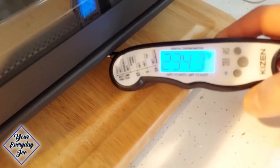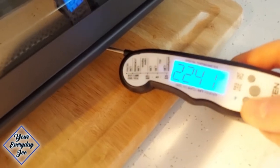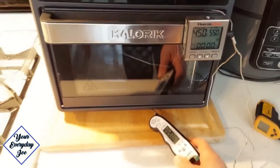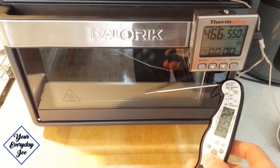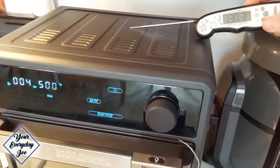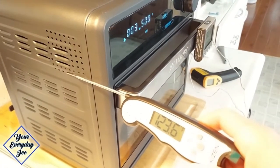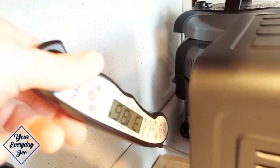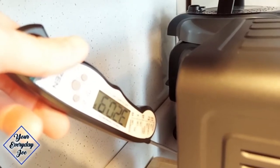While the unit was running at about 500 degrees Fahrenheit, I took some exterior temperature tests. At the bottom of the unit, running at 500 degrees, it read as high as 224 degrees Fahrenheit — kind of warm, but it did not burn or do anything to the counter. The glass on the door read as high as 268 degrees Fahrenheit when the oven was reading about 469 degrees — very, very hot. The top of the oven was only reading about 125–126 degrees. The left and right sides are a little warm to the touch, but definitely not going to burn you. However, the rear panel read as high as 323 degrees — if you put your hands on it, it will be very hot to the touch and can scald you. Be very careful there.